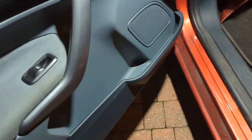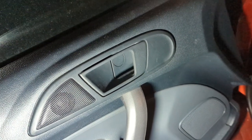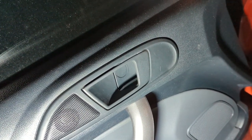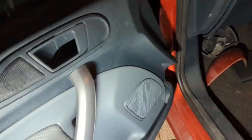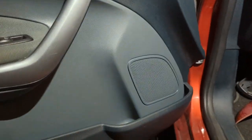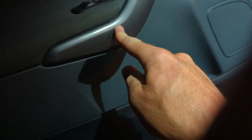To get the door card off - I've had Fiestas since the 70s but first took one apart around '98 - under the door handle there's a round clip; get a little screwdriver under that and pop it out, there's a bolt underneath. You've also got this plastic trim here that needs to be prised off. I used a flat-blade screwdriver, got it into a place where you wouldn't notice any marks, and inside there is another bolt.